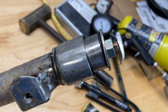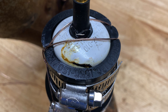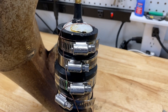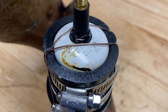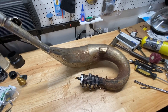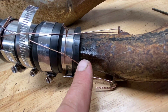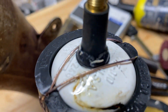After the exhaust pipe cooled down I took the duct tape off. The neoprene expansion plug didn't move at all. On the other side with the PVC cap and rubber coupler, I did notice some oil seeping in between the PVC cap and rubber coupler and also between the exhaust pipe and the rubber coupler — though the coupler itself didn't move. Around 85 to 90 psi was enough pressure to let the oil mixture and air seep in, but it didn't really matter because you can just keep pumping compressed air to get the pressure back up. The max I went was about 90 psi.